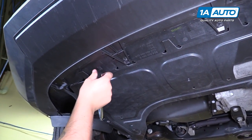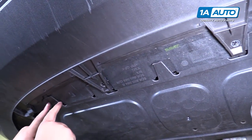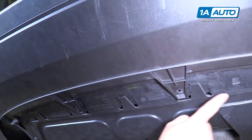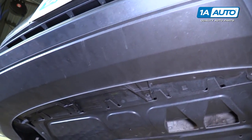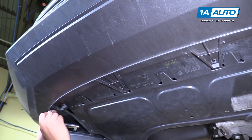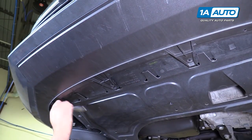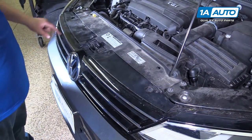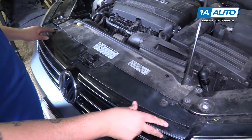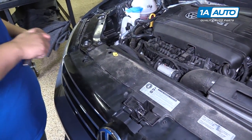To reconnect the shield back up to the car, make sure when you put the bumper on that these actually slide over the skid plate and lock into place. Take your hardware and, starting from one side, screw the bumper back into place. As the last step, take the remainder of your T25 bolts, line up your grill on the top, screw it down, and you should be all set.